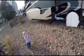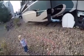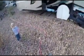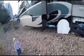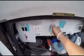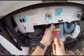So what I've done here is I put it at 30 at first, and then when I looked at my gauge, it was only about 20. So what I did is make sure that there's 30 at the line. I added this tire pressure gauge here, and you can see as I keep holding it down, it actually goes up to 30 psi. So I know I have 30 at the line now. So I can take that off. And all we do is just add it right here to our water for flushing, or where we add the city water. That's where the air goes in.